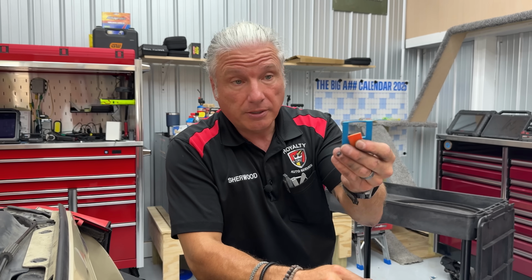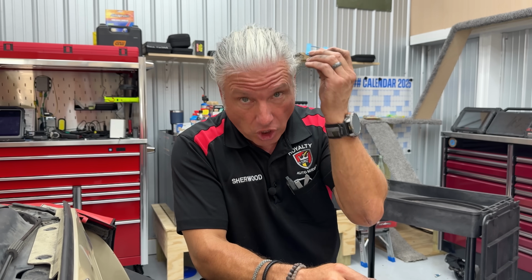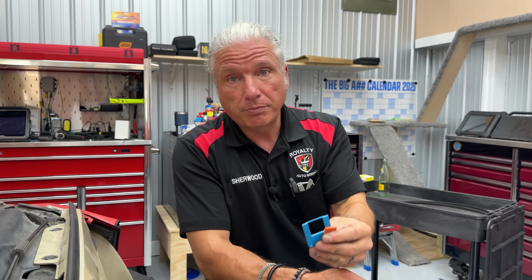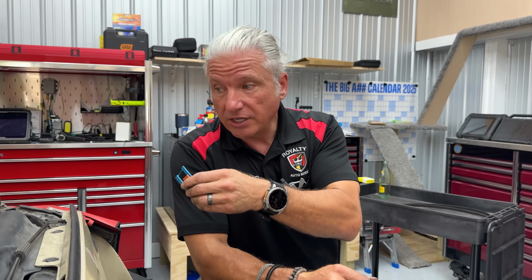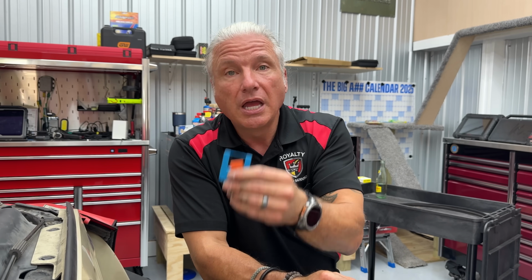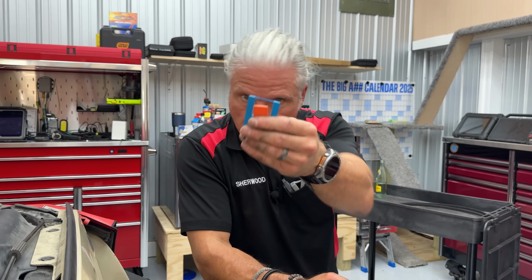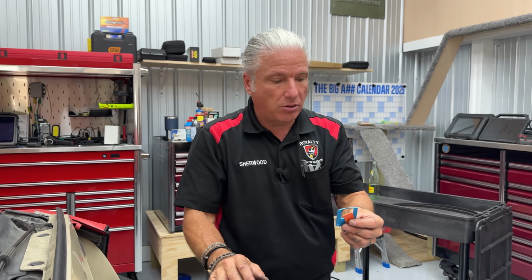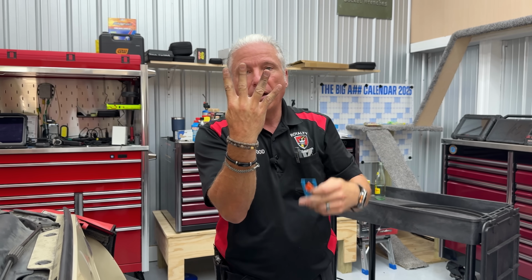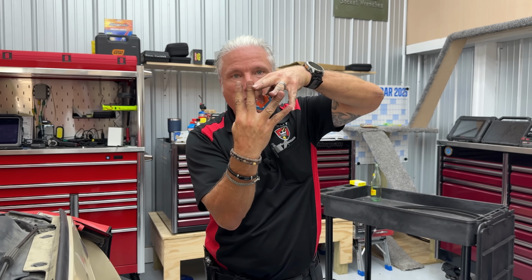But anyway, go get them. If you're a technician, go get these, put them in your toolbox, use them on every car, and make sure people know when they need to replace their belt, it's not going to crack. Educate your clients. If they say, well, I don't see any cracking on it, maybe they're somebody who looks under the hood, educate them on why, right? You send them this video, show them this video, and make sure they understand that it's not going to wear like it cracks all up. It's just going to get, the grooves are just going to get wider and wider and wider.